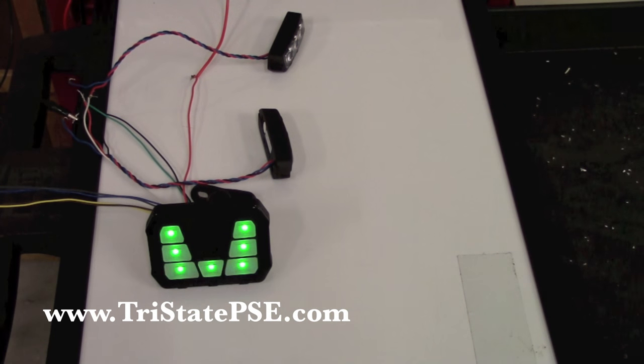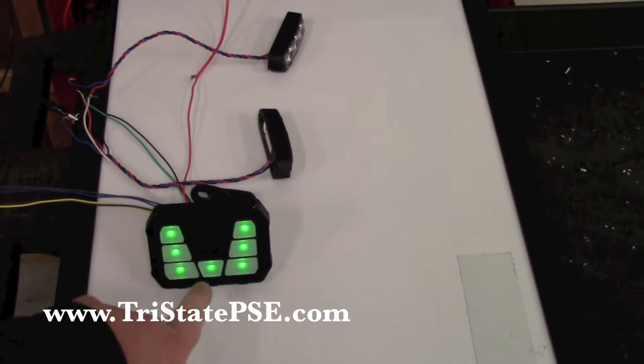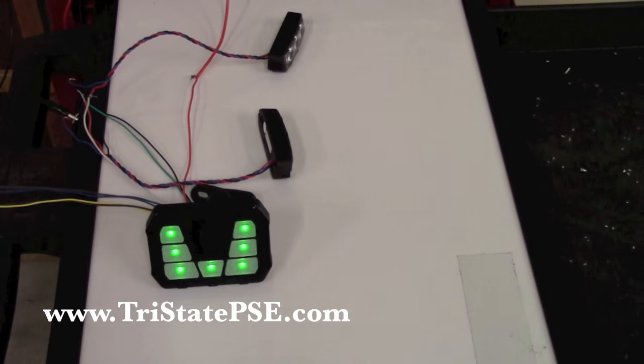We're going to go over the wigwag or headlight flasher feature built into the unit. The instructions are very simple and are found on our website with our product, which will link you over to Phoenix's website. Essentially what you do is press the on/off button to turn the system off, then press and hold buttons one and two — the top left and right switches — simultaneously while holding the on button for three seconds. So all three buttons are held down for about three seconds and you'll hear a beep, which is audible recognition telling you the unit has been programmed. You've now enabled button one as the on/off switch and button two as your momentary switch to change flash patterns for your headlight flasher or wigwag system built into the unit.